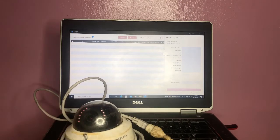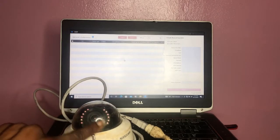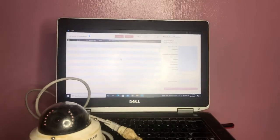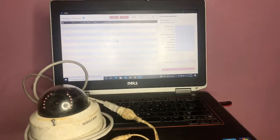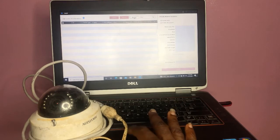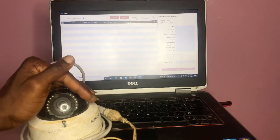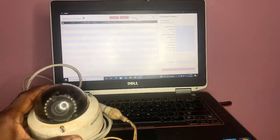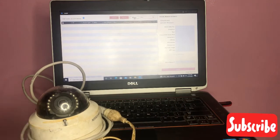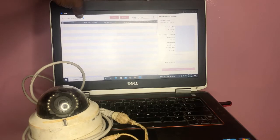The power port is not damaged — you can see the light on the camera. But if you watch the PC screen, our SADP software tool has not connected with the camera. We'll click refresh. If the network port were good, the camera IP address would display on the SADP tool, but right now we have no display.